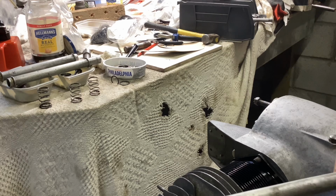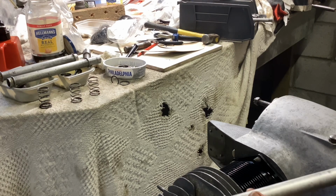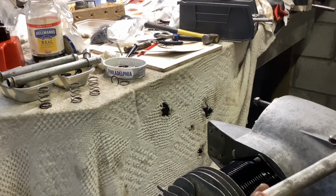These are the pushrod tubes. They're very soft aluminium. They get bent and damaged very easily. In fact, this one I've straightened. It had a big dent in it here as well, which I've pushed out by putting a bar down the inside. It was somewhere around 11/16. Sort of massaged the bar down there and tapped the dent out with a rubber hammer.